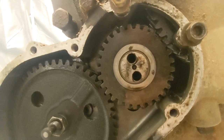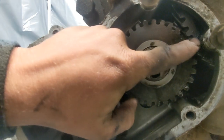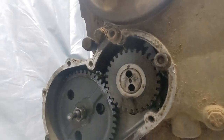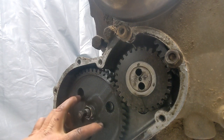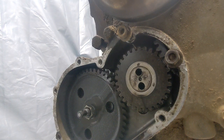There's a punch mark here, two punch marks there - no punch marks on this gear though. I get that it doesn't matter where this one is, but how am I going to make sure that this is the correct timing with the camshaft? Because that's what decides when it fires the injectors. I'm going to put punch marks on it. Since this one already had two punch marks, I just punched kind of the middle of them so I'll be able to line that up. And over here I punched these two teeth and this one, so I'll know to put those back together.